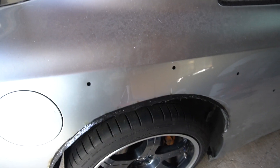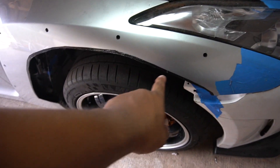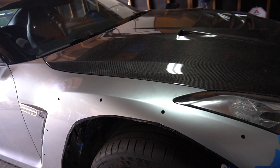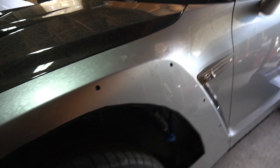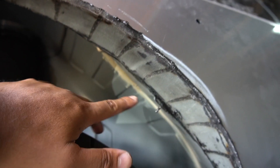It's been about an hour or two to let everything dry. I got a little too OCD on some stuff. The original game plan was just to seam seal the rears, but then I figured while I let this dry — this is totally not necessary — I went ahead and seam sealed the front fenders as well just to make it look nicer. It looks a lot cleaner now instead of having those ragged lines. I had the whole bottle and didn't want to waste it. Being that this is backed by plastic and bound together with the metal, I didn't want any water or debris separating it, so I just closed this off to make sure everything's tight. I also seam sealed everything on the other side — there were some flaps and a little bit of separation in there, so I figured why not just cover everything.